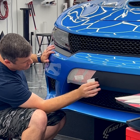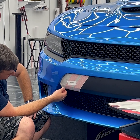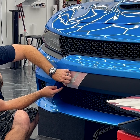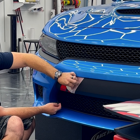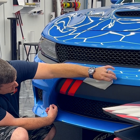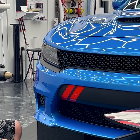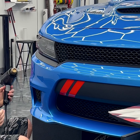That's all there is to it. At this point we're going to remove the transfer paper, then come back with the heat gun to make sure the decal is conformed down to the surface. Be careful not to pull up one of the corners when removing the transfer paper. Get the transfer paper completely off, then introduce a little bit of heat so that the vinyl is conformed to that texture and will stay long-term.